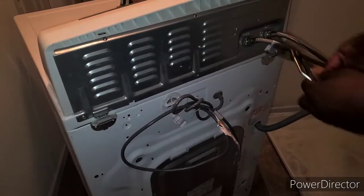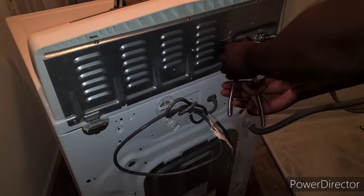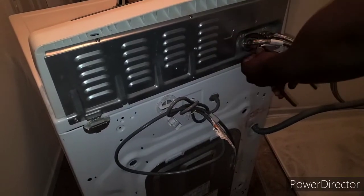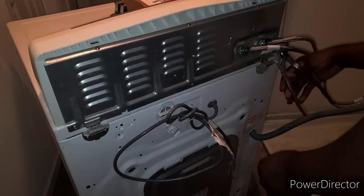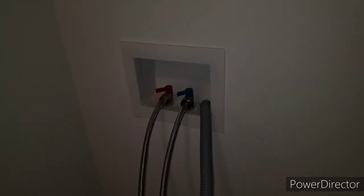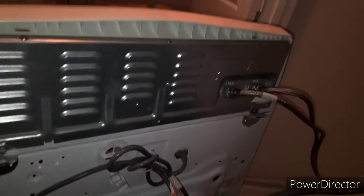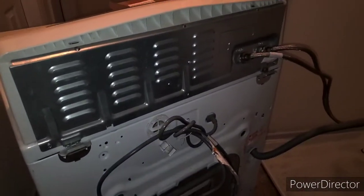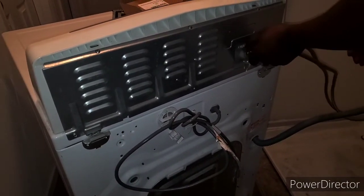The first thing you're going to do is take off these hoses. I like to use a pair of pliers because they're pretty tight. You're going to get a little water coming out of here. Before you do this, please make sure that you turn off the water from the main valve, because if you don't it's just going to spew out everywhere. All right, we got them loose.